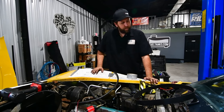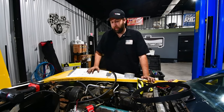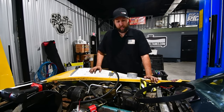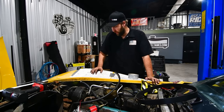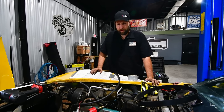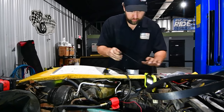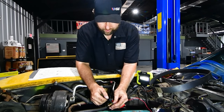And then I get to drive around town later tonight and try to find some actual good fuel, something hopefully 96, 98 octane, even 93, as long as it doesn't have that cornmeal stuff, oatmeal, whatever it is. And that's gonna help detonation and my timing on the blower. And hopefully last 3 minutes, basically. High pressure approved. Of course, these are hyper toughs. You gotta use the good stuff.